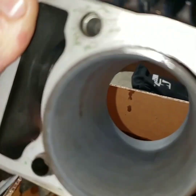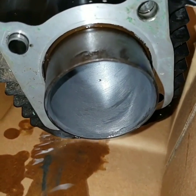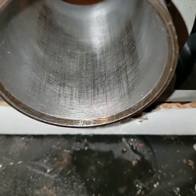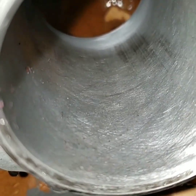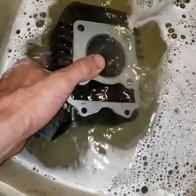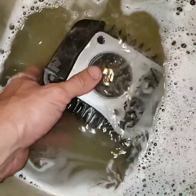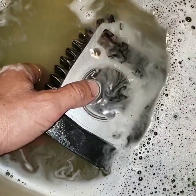I'm using my phone — I don't have a tripod or anything — so I'm going to get it to where I think this surface is cleaned up and I'll check back. It's cleaning up some, but I'm still seeing some scoring marks so I'm going to go a little further. This may be a lost cause but I'm going to try it anyway. It's improved, but I still have a ways to go. I'm making some progress but you can still see scoring at the top. Now I'm over at the sink washing it off. I took the cylinder to the point where I think it would be good, removing the scoring. I'm going to get my telescoping gauges and see what the limits are in the Grom manual and see if we've exceeded those or not.